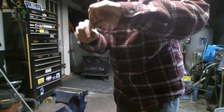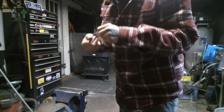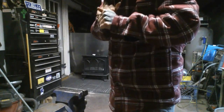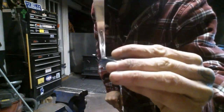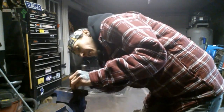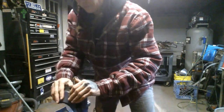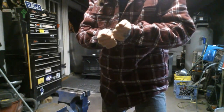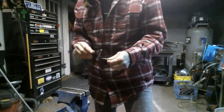Your first bend is going to be at the foot. I use markings on the fork so I can stay consistent. On this fork there is a name on the back, so I use that — place the fork back in there and I use that marking so I'll have consistency between the four legs. Just take it and bend it until you have your Z shape. You're going to want to do that with all four of the forks.